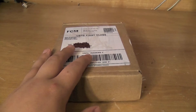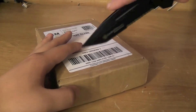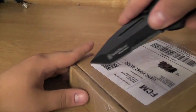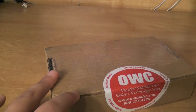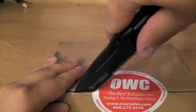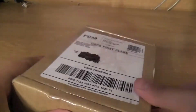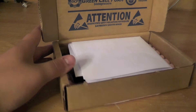Here's the box — I'm going to go ahead and open it up. I've blacked out the address because I don't want people mailing me stuff. Some reasons why you want more RAM: one thing I found with two gigs of RAM is that Lion uses a lot of RAM. Their minimum requirements are two gigs and if you're using two, it's difficult to do much of anything else. So four gigs is definitely what I wanted.